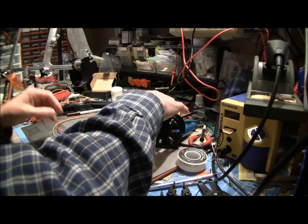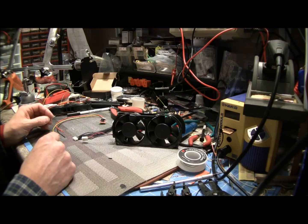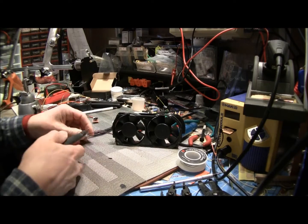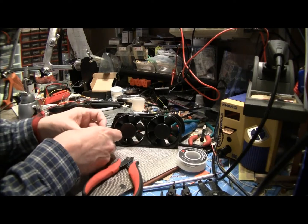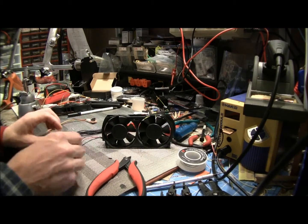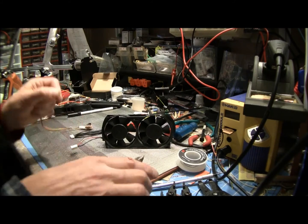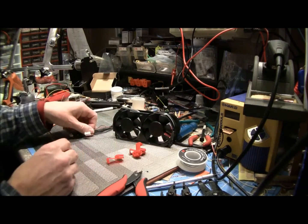Now we're going to show you, we've already done a GPU mod, so what we're going to do is go ahead and do the dual mod, which basically you would snip your CPU wire down low here. So cut your brown wire, and then we're going to go ahead and take the output, which is the yellow wire. Our fan mods come with a tinned end, so you're going to snip them off, since we'll be doing a no solder method, so we're going to be crimping with that.